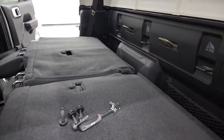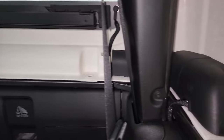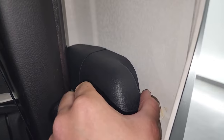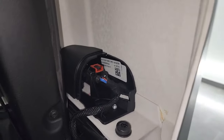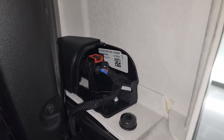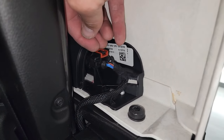You can see I have five of the six bolts out. You might say you can't see the last bolt — that's because it's behind this plastic piece here. You're going to want to grab right here and pull in towards the vehicle, and that's just a quick release clip. Now there is a wiring harness here — that red piece is kind of like a safety clip.